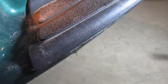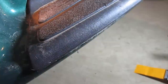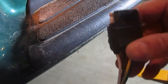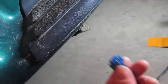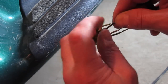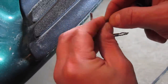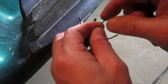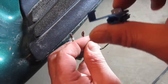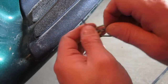And in the instructions, it does correspond exactly with what the four flat connector is. This is like a two foot connector which I don't need, so I'm going to cut some of this back. This Hopkins kit came with some crimp connectors, so I'm just going to use those to connect my wires up to the actual tail light connector. Even though I stripped off some of the shielding, I'm just going to fold that back because it's going to be hidden by the connector anyway. The way these work is you put the wire in and when you crimp it down, this metal piece comes down and cuts into the shielding and makes the connection — so you don't really need to strip it back. I just did that for testing purposes.